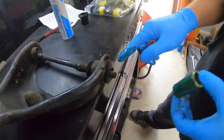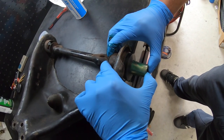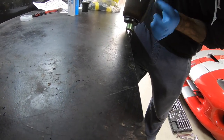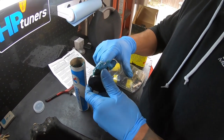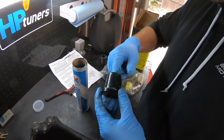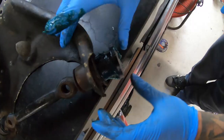I managed to get this in with my hands. I put a nice coating of grease inside, the outside, and also the sleeve - shoved that in with my hands. Here's the raw bushing - it has a bunch of grooves in there that I like to pack full of grease. I don't want the outside to slip but I don't want it to squeak either. I coat both ends of it, inside and outside. Get all the grooves filled and then we'll slide it in.